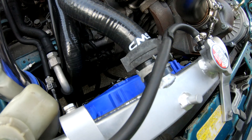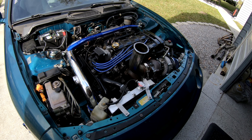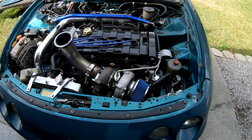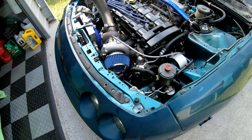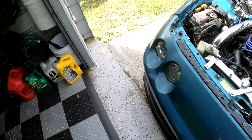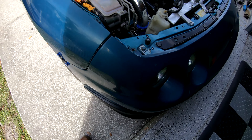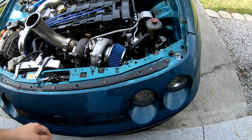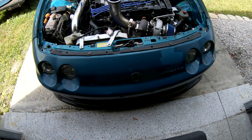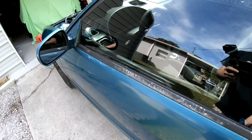I was a little bit worried about this because I've heard about them but never really used one — I usually like welding some bungs. I actually tried the no-weld fitting; it's got two crush washers with o-rings built in and it worked out really well, very clean. Got that all done. Got quick releases now on the front bumper because we're gonna be taking it on and off a lot when we go to the track. Those little screws are a pain to get out, so we did five up here — undo those five, pop the bumper off and you've got a lot of access to pretty much everything.